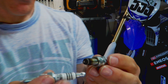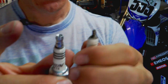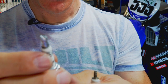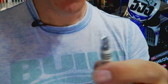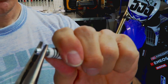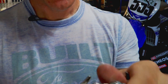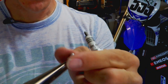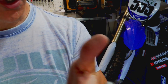You can see I now have the old spark plug and the new one. You'll notice the new one has a terminal nut at the top that the old one doesn't have. Simply grab it with a pair of pliers and unscrew that terminal nut — you can discard it as it will no longer be needed. That's what the terminal nut looks like — a tiny little thing, but again, no longer needed.